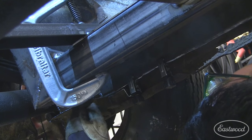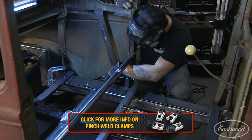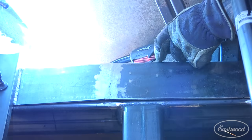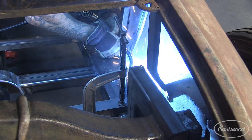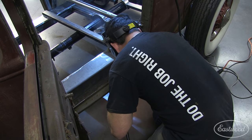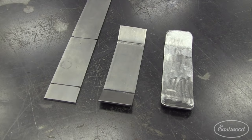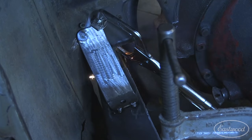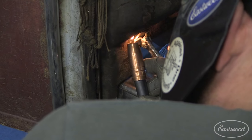With the braces all welded in place, we used mini pinch weld clamps and C clamps to pull the original rocker on the car against our new sub rails tightly. We then laid equally spaced stitch welds along the length of each side rail connecting the body to our new subfloor bracing. I then fabricated some simple front braces that will connect the firewall to the new subfloor. Next, we clamped the braces in place and reused the original rivet holes to plug weld the braces to the firewall and stitch welded them to the subfloor.